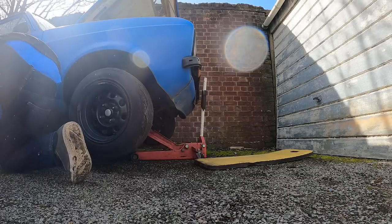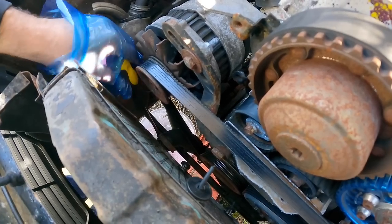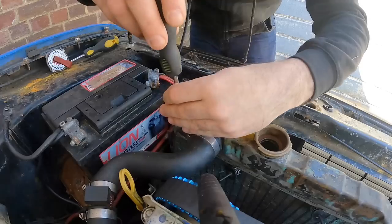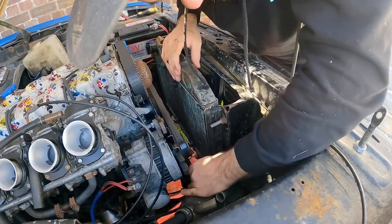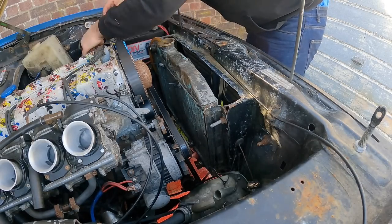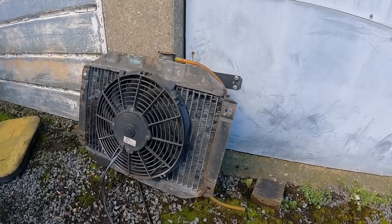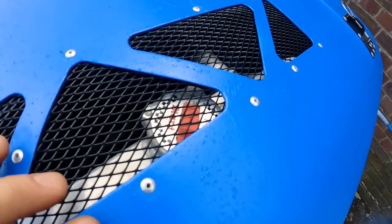After jacking Maud up and putting her on axle stands, I cut the cable ties that were holding the bottom radiator hose to the anti-roll bar, then disconnected the bottom radiator hose from the radiator to drain the coolant out — some of it went into the bowl. I then disconnected the top radiator hose from the radiator and set about removing the radiator from the car. I had one cable tie to cut at the bottom on the driver's side, disconnected the negative terminal on the battery, removed one nut and bolt from either side of the top of the radiator, and disconnected the wiring for the electric fan before lifting the radiator out. With the old radiator removed, I could then trial fit the new alloy radiator, and it was immediately apparent that there was a bit of an issue.